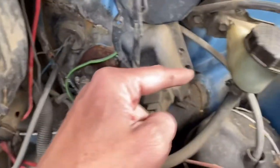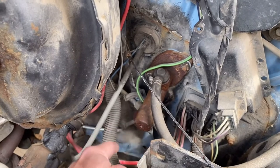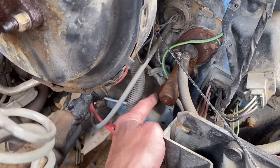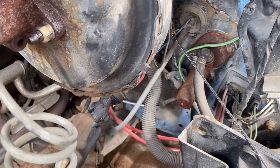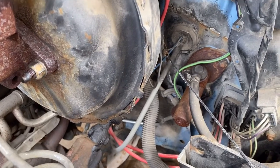We're going to have to drain the clutch reservoir through this hose into a container. We're also going to disconnect this hard tube from here, replace it, put it all back together, and then we're going to drain the line and change out the slave cylinder as well.